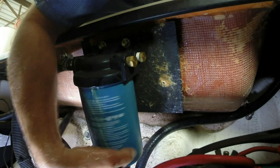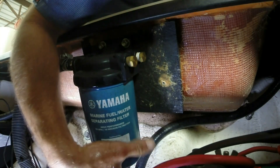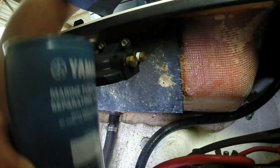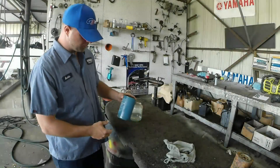You're going to have some fuel leak out. This one's on a bit of an angle, so it's running over the top. At this point we'll go ahead and take it out and dump it into our cup and see what we have. The fuel water separator is out.